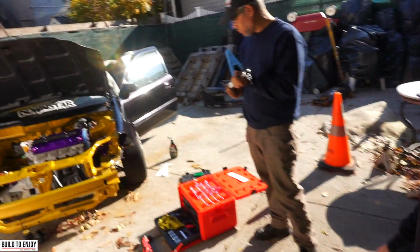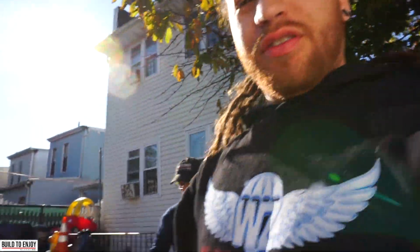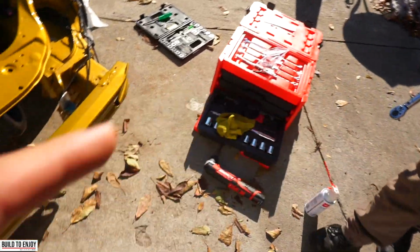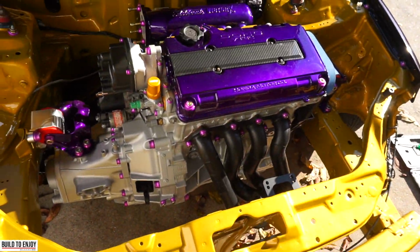Alright, so the heater coil is in. Ran into a small issue, but we fixed it. Manifold is on now. Gonna get the torque wrench, tying it down. Torque it to about 18 pounds of torque, which should be it. That's the only thing I'm gonna be able to do today because I got to work. That took more time than we thought. But yeah, so we're just gonna do that, and then probably like Sunday or something, gonna just finish it up and then do the rest of the stuff that needs to be done.